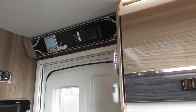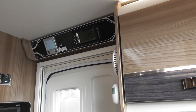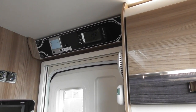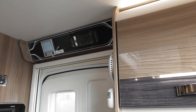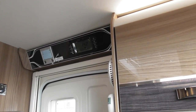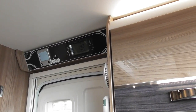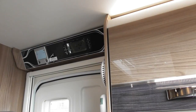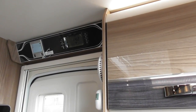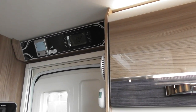In the summer, one, two or three kilowatts is plenty sufficient to heat the water, because you've got 10 litres of water in that tank. In the winter, that system will want to heat the whole van as well — 10 litres of water and this van on say two kilowatts is not really going to happen. So what you can do is put the gas on as well. What it will do is use both energies to get up to temperature, shut the gas off, and continue ticking over on electric.